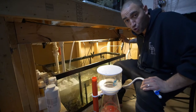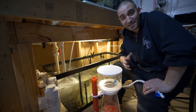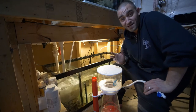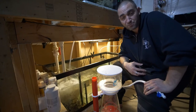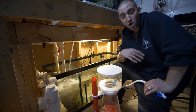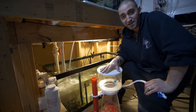I look at the controller right here, and there are LED lights on it. I looked on the website, and it shows that depending on what's wrong, some LEDs will go out. So which LEDs are illuminated and which are not will tell you a code for possibly what is wrong, for example the controller, the AC-DC power supply adapter, or maybe the pump, or whatever else. There are a few troubleshooting codes I found on fishstreet.com, underneath the Coral Box Cloud 9 protein skimmer, so I just wanted to hopefully resolve the issue.